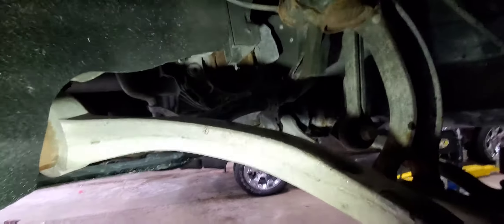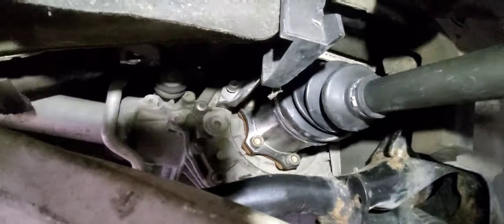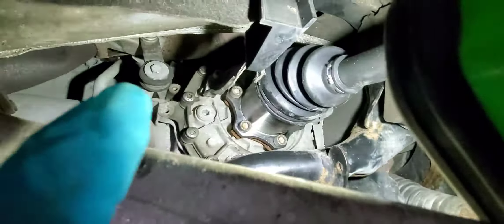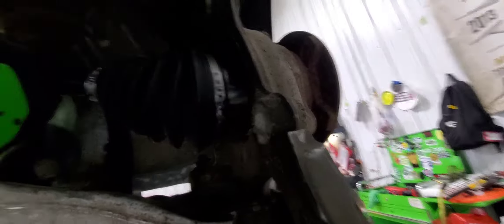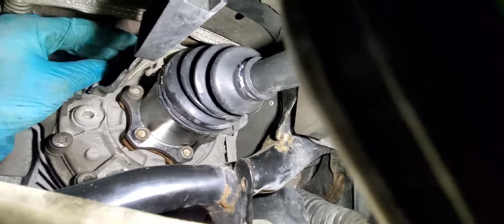I'll get it put back in and we'll get these brakes done. I went ahead and took this shield off so I can show you a little better. You can see right up in there — there are some H6 hex key bolts, three of them all the way around this little plate. I took two out and left one on the very other side loose so I could pivot this up, get the CV axle stabbed in over the hub, push it over, drop it back down — that way I had plenty of room to get everything back in.